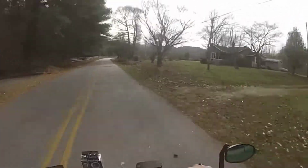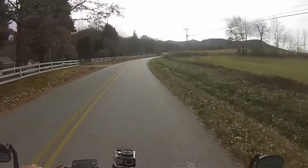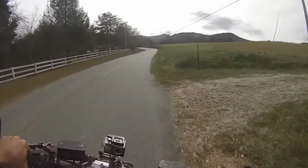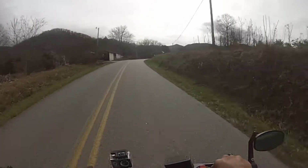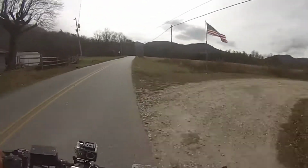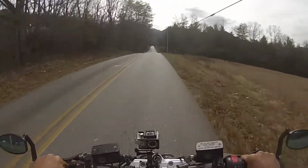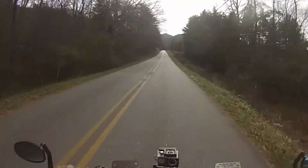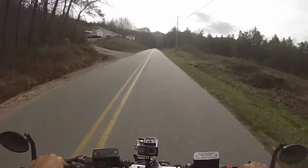So fortunately, I got my clutch situation sorted out, and I haven't whacked on it real hard yet, but I'm imagining how it's acting so far since I scuffed up those steels, that even when I'm really getting on it in third, fourth, up on the mountain, it's going to hold. 'Cause it was slipping already before.